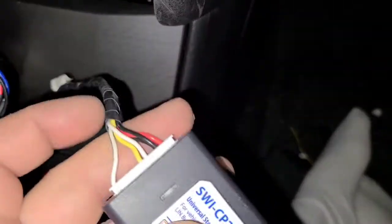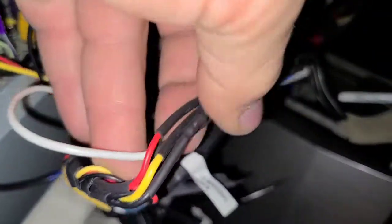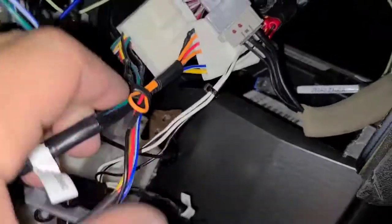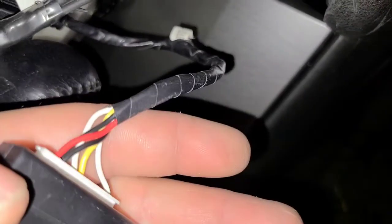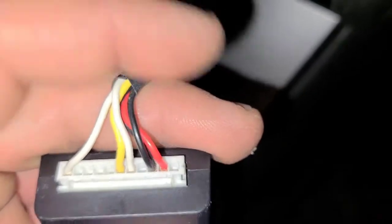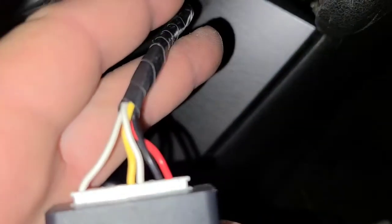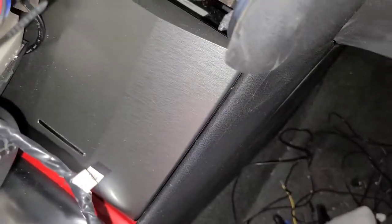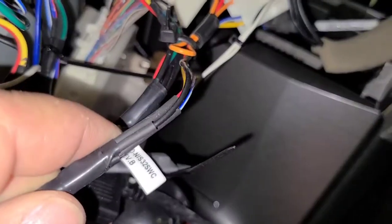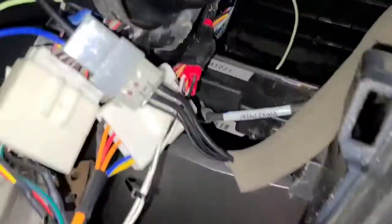Once I figured that out it works great. Do yourself a favor and wire it all into the same harness — yellow, red, and black — so you don't have power and accessory wires scattered everywhere. There are two black ground wires: one for the chassis and one for this unit. It doesn't matter which goes where since it's just two wires into one ground point, but make sure you capture both.